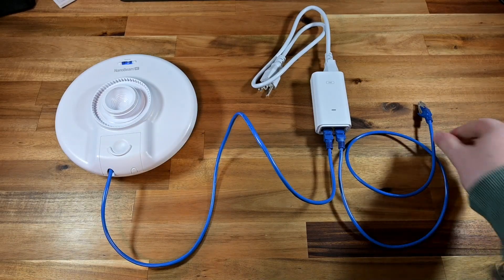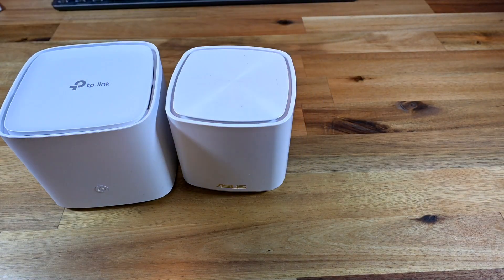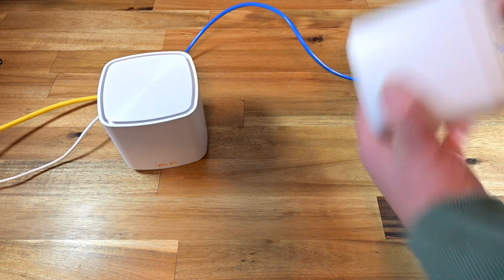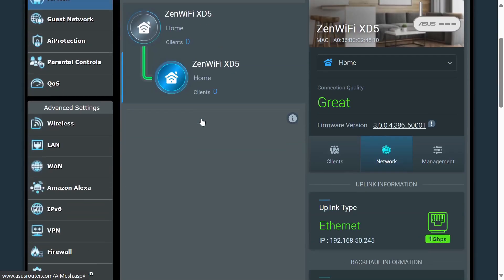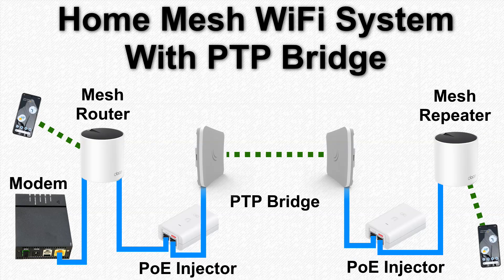On the far side of the wireless bridge you'll end up with a wired network connection. The most common thing you'll want is to get wifi out of this for your devices, and there are a few ways to do it. Mesh wifi systems from Google, TP-Link, Eero, and others are popular with little effort — you use one unit as your home router, add units where you have weak coverage, and they wirelessly connect back to the main unit. Most of these systems also support wired backhaul mode, where a unit gets its connection via its wired network port, usually turned on automatically when hardwired. All you should have to do is pair the second mesh node with the first, then connect the LAN port to your bridge.